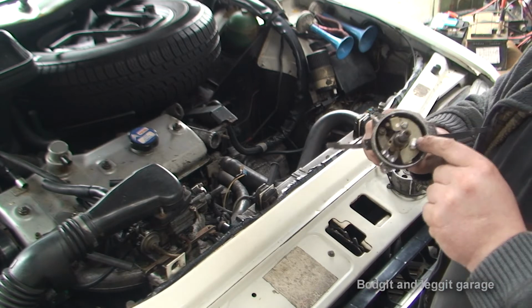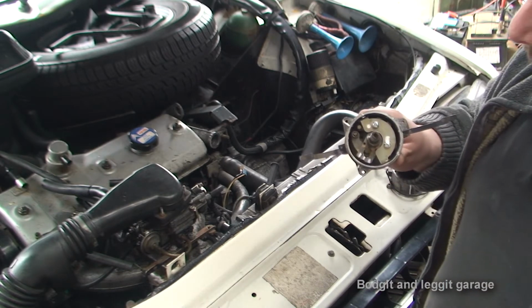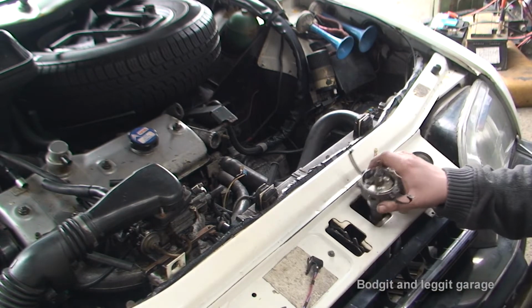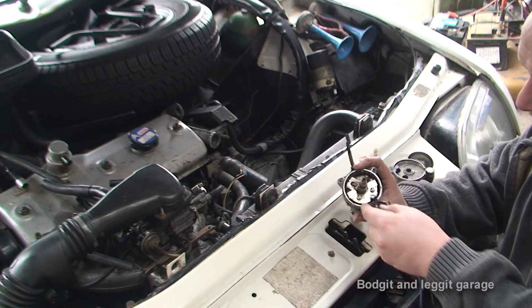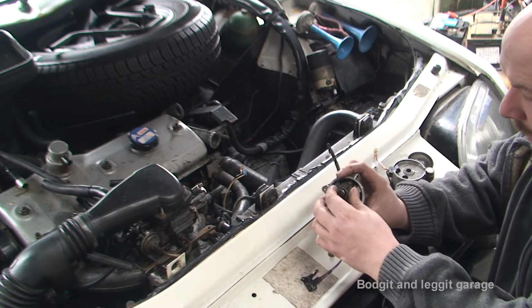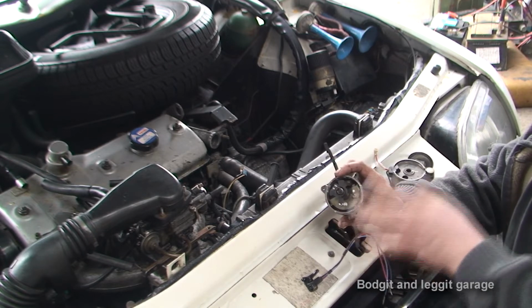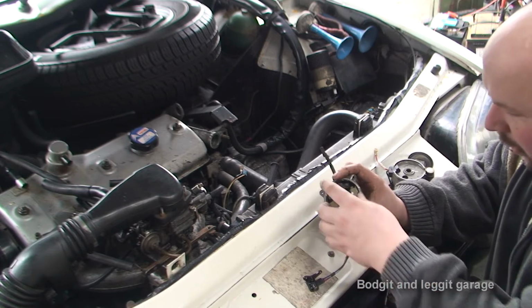As you can see, I've got two spots in here because I have to slightly move the actual electrode part to the side. Right, the tricky part was getting this bracket lined up properly so the infrared detector would then line up with the chopper, and not only the chopper, it would also line up with the rotary arm spark. So everything had to line up together, which is what took me such a long time.